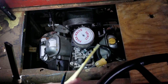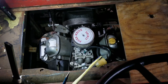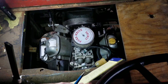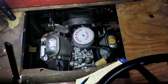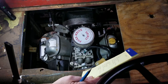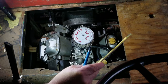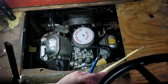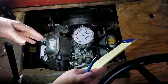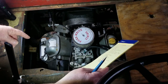Why did we change the coils out? What we were getting was, even after we changed the electric fuel pump out and took the diaphragm out of the loop and put it directly in, we were getting way, way too much fuel. But it doesn't look like you're getting too much fuel — it acts like it's actually starving. The end result was the plug's getting wet, but the implication is the fuel's not firing. In one of my earlier videos there was this odd scenario — that could have been the coil — where it would fire on this side, it wouldn't fire on that side, move the plug over, it would fire. Really weird.